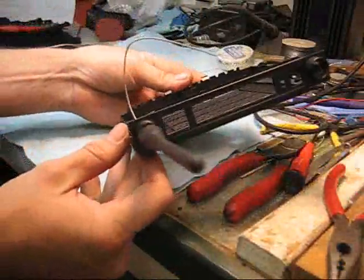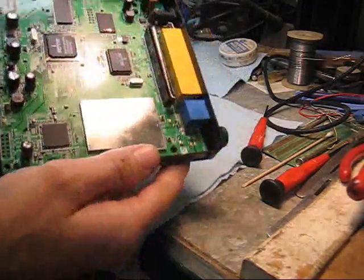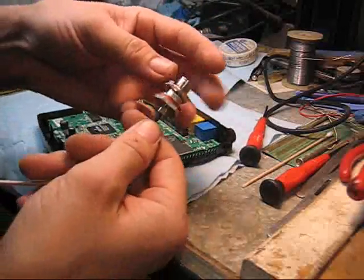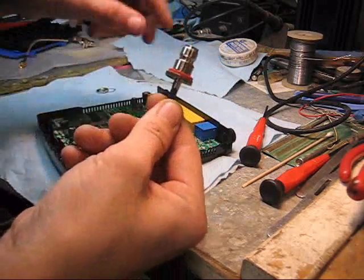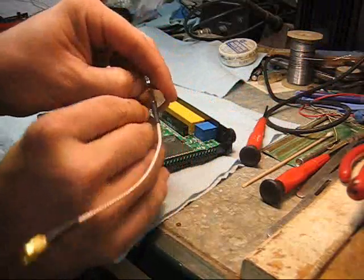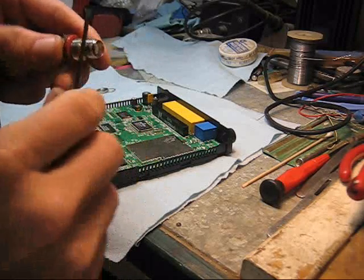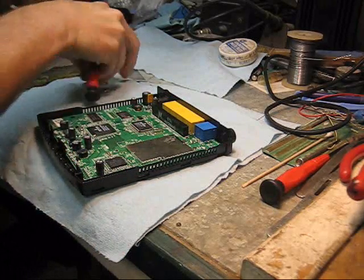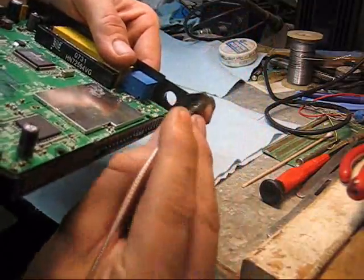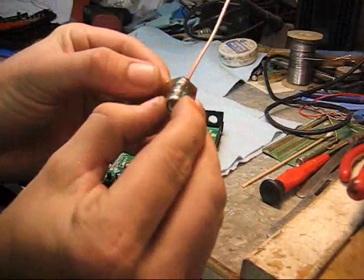On this next part, I went ahead and put the board back in there just to show that I'm going to have some clearance issues. I haven't yet drilled this, but I'm noticing already that on this particular style that I bought, it's got a lot of room right there but it looks like it will not clear the board. So what I'm going to end up doing is using a bench grinder to grind that down so I'll get some better clearance. I'm going to have to trim off some of this right here — you can either do that with a regular rasp or file, but I'm going to use a bench grinder.